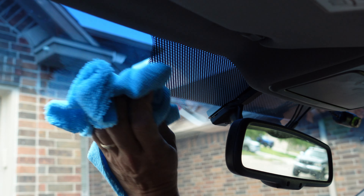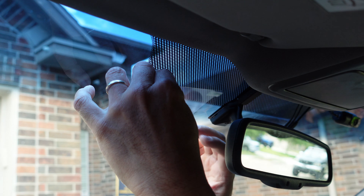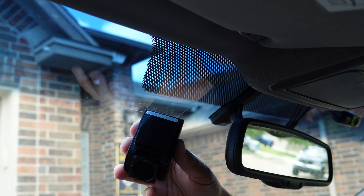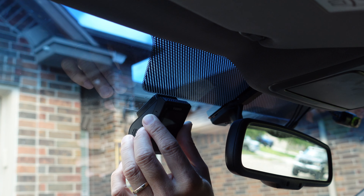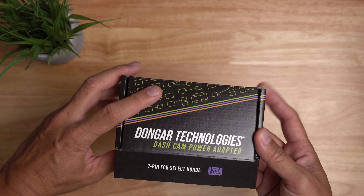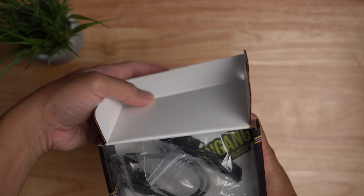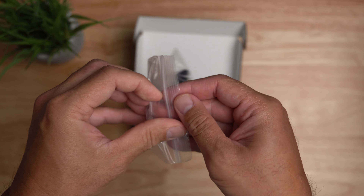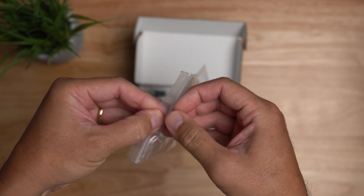Time to install this. First, make sure the windshield is clean. Peel off one side of the transparent film as per instructions and stick it to the windshield, then peel off the other side. Remove the liner from the 3M mounting tape of the dash cam and stick it to the transparent film. As to power, I'll use a Dongar adapter which taps power from your powered rear view mirrors — just take note that this is a vehicle-specific adapter, and this one is for an older Honda Pilot.